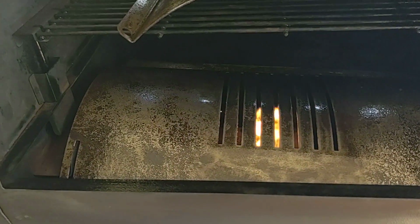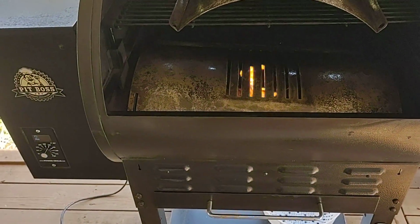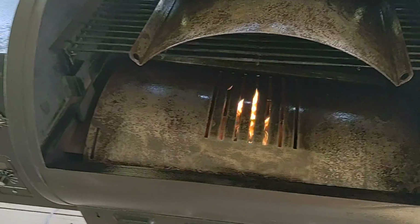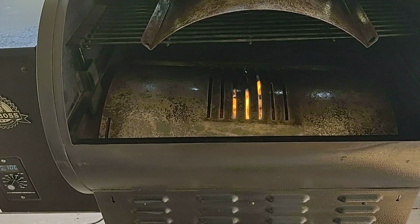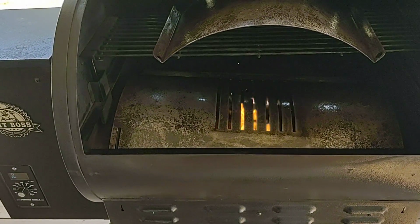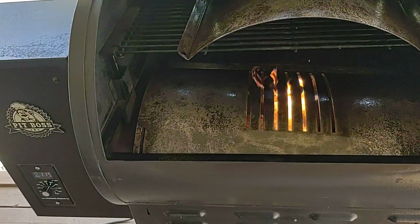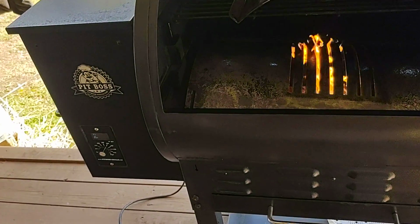I just want to give you my take on the Pit Boss and the little issues I had. Like I said about the rust, that was my main issue, the main reason for doing this video, just to give everybody a heads up of what to do. Because in my book, my manual as far as maintenance and care, it does not tell you to season them plates. I thought about this and didn't do it. In about June, July this year, I realized I'm going to have a problem here. By next year, this would probably have burnt through, and I'd have that one burning through with a hole. So, just to let you know.